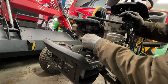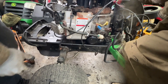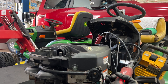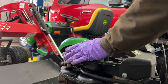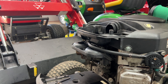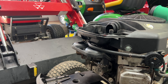Put the gas cable here, put this all the way down, all the way up and choke - I'm just leaving those all the way up. Looks good. Put some oil in the motor and a filter, I'm gonna put gas in the gas tank and put the spark plugs back in and put the cover on. A little bit of gas in here - perfect. All right, I like that - no blue smoke, no nothing.